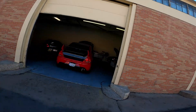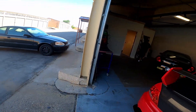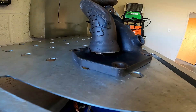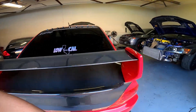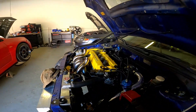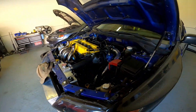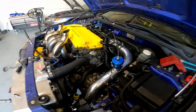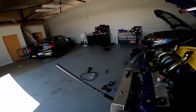Early morning, back at the shop. The red Evo's wastegate flange is all messed up — I'm going to weld that up and throw it back on. Oil pan is good, valve cover is good, coil and plug are all on. Just going to do the starter plate, starter, and downpipe. Then the catch can — a couple of the lines and I'll get some lines over there.